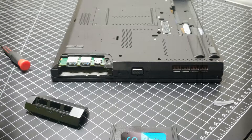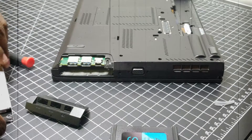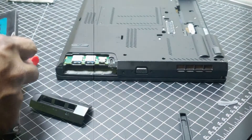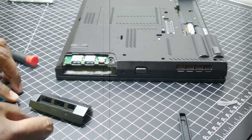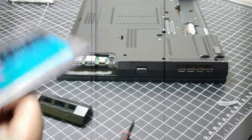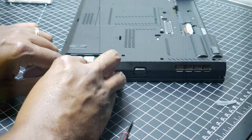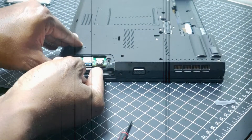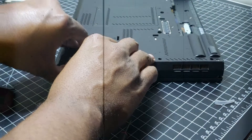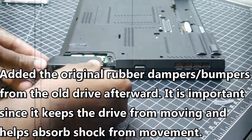So now this should separate. Since this is a 2.5 inch drive - which is what it actually is - and this is also 2.5 inch, it should fit in the tray and it does. So I don't have to use their adapters, I use the ones that came on the laptop. Make sure you tuck this under because you have to put the door back on, then slide this in there. Once you get it in there it's going to go right into those two connectors and you are good to go. Everything should be seated and we'll find out shortly when we turn this bad boy on.